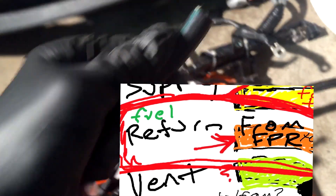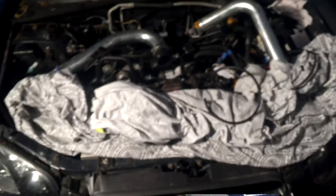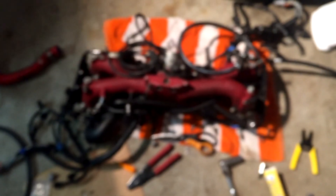Here's my FPR return, which is attached to a 5/16th line, and this is going to go straight to the fuel dampener. This will be my return line — I'm not sure exactly how to route it yet but it's going to be routed under my charge pipe. It's not a front-mount setup. That's kind of the gist of it — the instructions are clear but it takes some visualizing and some manipulating.